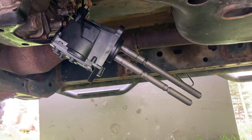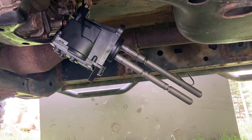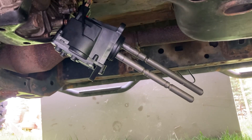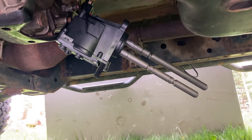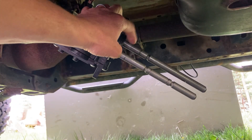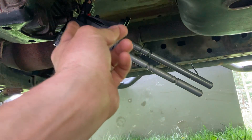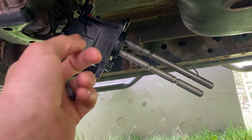My vehicle shut off — I left it on too long so the battery is low. So this rod is for your center diff lock and this rod is for your four-wheel drive control. I'll post another video that shows how to disassemble this actuator; you can then reassemble it after you install the two rods. The rods will not come out of your transfer case unless you disassemble the transfer case, but the rods are sticking out.